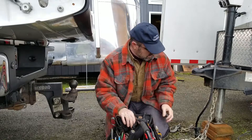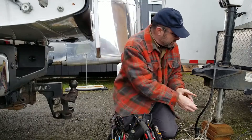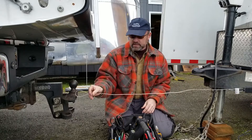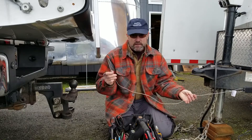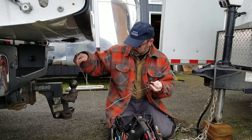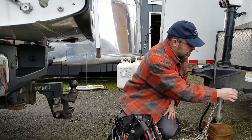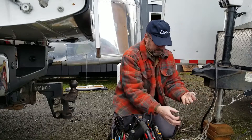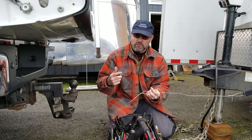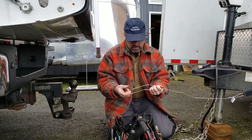Here's my trailer ball and hitch. This end connects to my tow vehicle. Different ways to do it — during a pre-trip people will unplug this connector, loop the cable around something, and loop it back through making a lasso. You don't want to put it on the tow chain; it needs to be attached to the tow vehicle — something solid, something stout. On mine I hook it up to eye bolts.